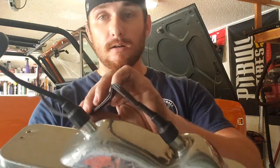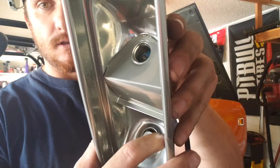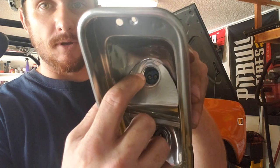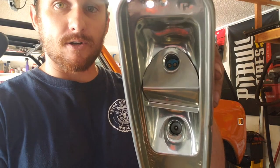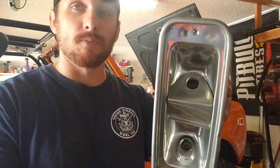So I got the wiring put back in one housing. All I got to do is reconnect the matching connectors for the ones that are in the vehicle, from the weather packs. Similar to OEM, not quite exactly the same, but it'll do with what I had. This one just slides right in there with the spring — it's for your reverse light. You're going to use the middle notch in between the two for your light bulb, and the blue plastic piece will slip all the way down with the spring underneath it. Make sure you get tension back on these springs — that's what holds tension on your bulbs.